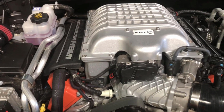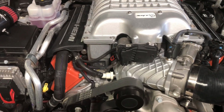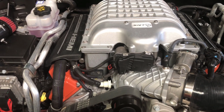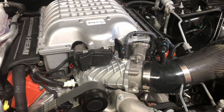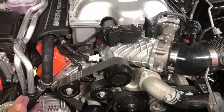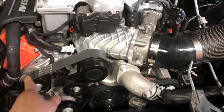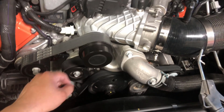So you want to have that, like I said, not for performance gains or to look cool, but as a preventative maintenance type of thing. I know right now, for a lot of these 700 horsepower builds it might not be a lot, but with the plans that I have for this engine, hopefully by the end we're gonna have between 820 and 840 horsepower to all wheels. So we're gonna switch out injectors, colder plugs, upper pulley, lower pulley.